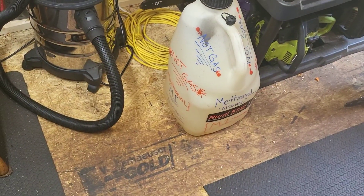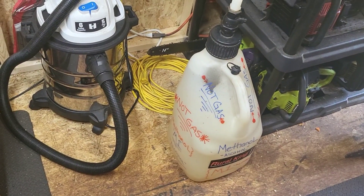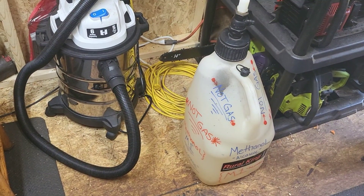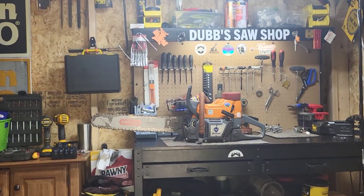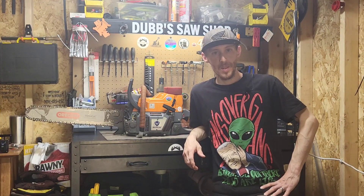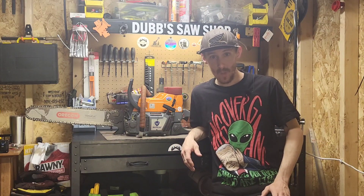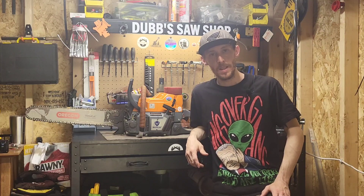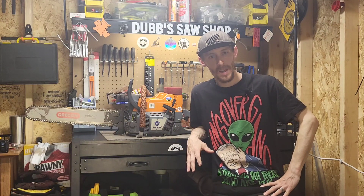I think Smitty and the muffler have brought me to the dark side. I've got to get another jug for it. I did come across five gallons of VP M1 methanol — not gas. I'll either blow something up or blow myself up, or we'll figure the thing out. From what I understand, you don't want to leave it in a clear jug — don't want the sun to hit it because it breaks down, and it's alcohol so it loves to attract water. We're probably going to buy a different jug and get a couple more so we can pull out just a little bit at a time as we need it.